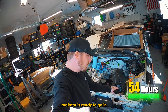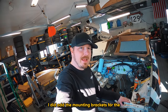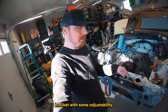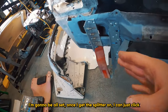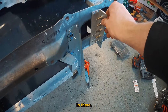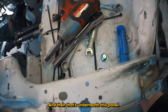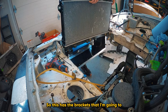I think that's a wrap. I have the radiator ducting done, and the radiator's ready to go in — I won't permanently install it until the motor's in. I did add the mounting brackets for the standoffs and the struts for the splitter that hold the ends, though I do need to get longer rods. I was able to test fit and then added a bracket with some adjustability — I have five different locations I can potentially go to all in this one bracket. Once I get the splitter on, I can click into whichever one makes sense, bolt it in place with lock washers and Loctite. On the other bracket, I actually found a factory hole and was able to use one of the M8 bolts and go directly into that.